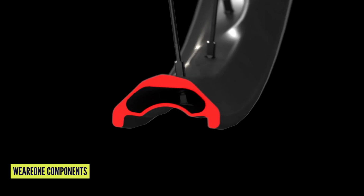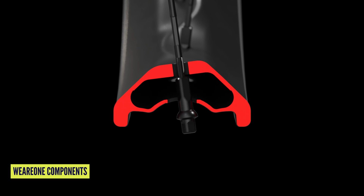They've focused on single wall impact failures and reinforcing certain areas to make it stronger. But the big thing is, if you check these out on screen, you've got that wavy pattern, and what that allows is a 7.5 degree alternating faces for the spokes and the nipples to interact with the rim. And apparently this reduces noise and also fatigue around the nipples too.